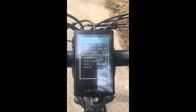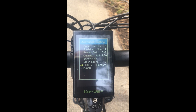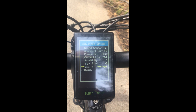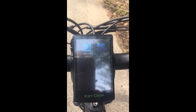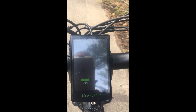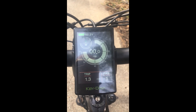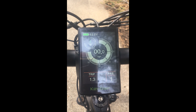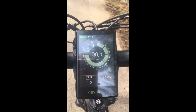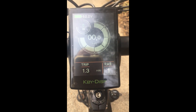The current limit is the current of the controller — this one is maxed out at 25 amps, though the KBO controller is only 22 amps anyway. You can also set the battery display to show percent or voltage. We're going to set it to voltage. Back on the main screen, you can see 52.2 volts at the top. This is useful because the bike cuts off at about 41 volts, giving you a clear idea of remaining battery.